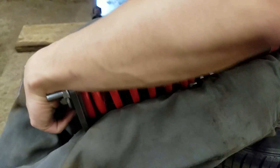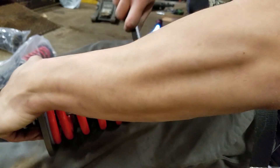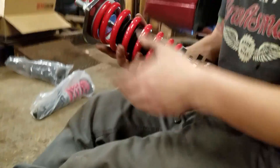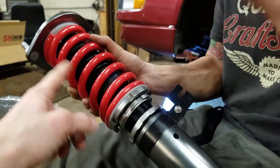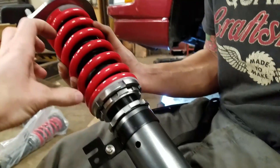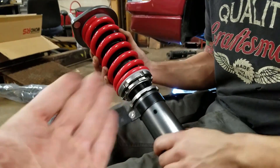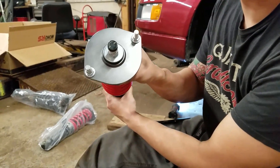All right Twan, what are we doing here? We're setting the preload on the springs so it doesn't slop around — got to make sure we do it on all of them about the same way. You don't want to over-tighten them because you'll ruin this bushing right here. So basically all he's doing is setting the preload — compressing the spring a little bit, not too much but not too little. This is so we can break in the spring, and then we'll throw these on. After that we'll actually be able to adjust ride height. We need to put a couple miles on to break in the strut itself, and then we can dial in the hard and soft settings.